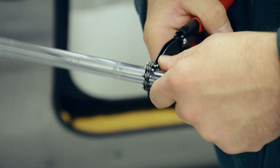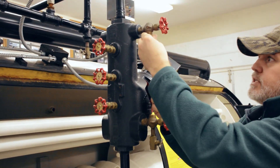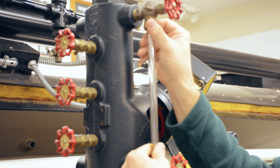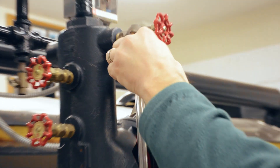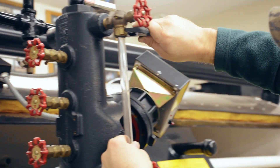Cutting these things really short can be difficult, which is why using a scrap piece might be a better option. Once you have it cut short, you're going to want to reinstall just one side of it. You can see I left my brass hardware off the bottom — I'm going to run that up, snug it up real tight, and essentially what we're doing is checking to see that this vertical orientation or vertical reference line matches up to these two valve faces.